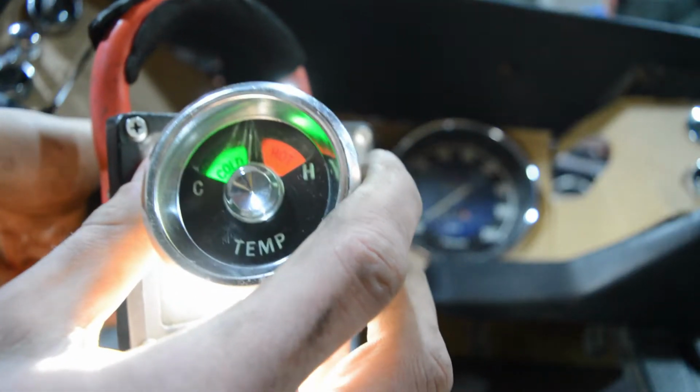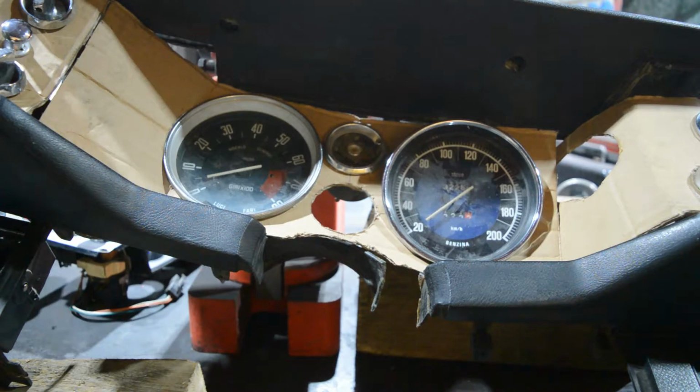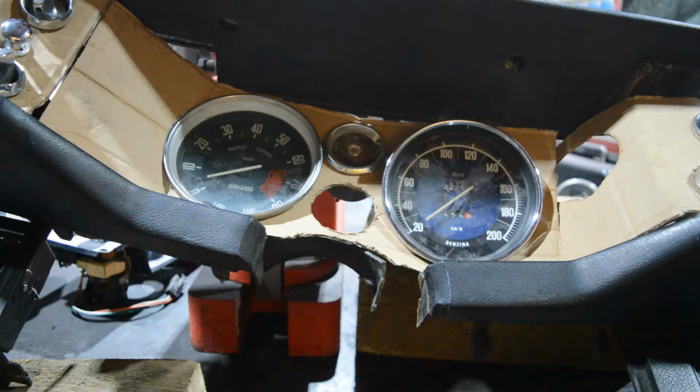The cold lamp, I'm not sure how it worked when it came out of the car, but where this is from, and actually this clock's from, because they have the same style. When you start the car and it's cold, the cool lamp is always on. When you get to operating temperature, it switches to hot, to the red lamp. And this light up here is basically the same thing as the cool lamp, because I think this is on as long as the car isn't at operating temperature, and as soon as it turns off, the car will be at operating temperature. So you would know, okay, now I can just floor it. And this is basically the same, but cooler. I'm still going to connect this one to this cool lamp because I have a spare lamp there and I don't want that to be not illuminated at all without function.